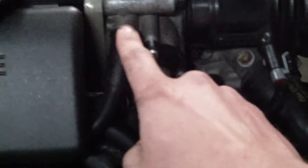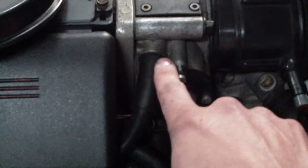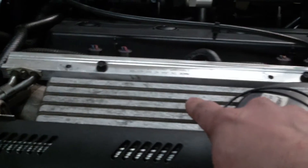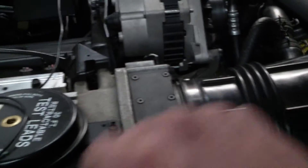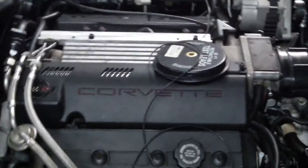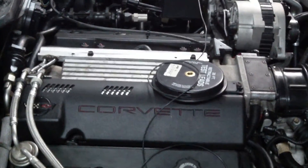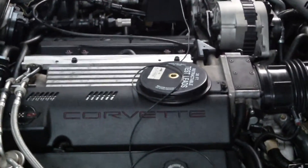This is just a fresh air inlet for the PCV. Here it comes off filtered air, gets drawn in here — there's no vacuum here. Fresh air is drawn in through the tube into this side of the engine, and it gets pulled through by the PCV system and into the intake and burnt in the engine. Pretty simple. Make sure your valve's good, your piping's good, and you don't have pressure inside the crankcase — check with a vacuum gauge.